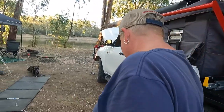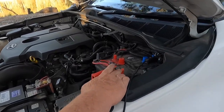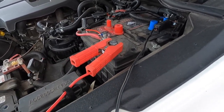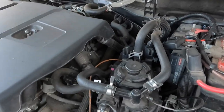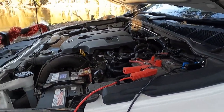So we've now got a good system set up. We've got a dual battery — the battery at the back is our second battery. I've got it clamped at the moment onto the positive and the negative. We've also got a RedArc BCDC little unit in there as well. The driving battery charges the second battery when we're driving, and that second battery runs the fridge. The only thing we use that second battery for is running the fridge.